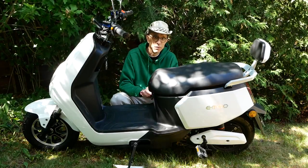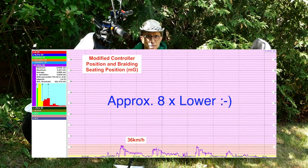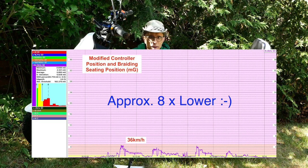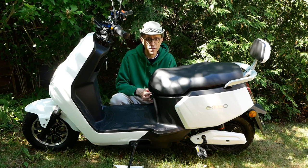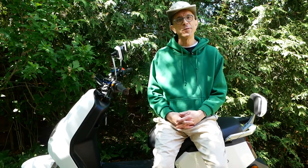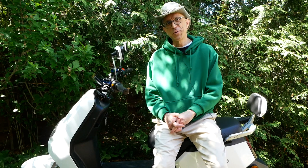Here's the chart showing the levels we had before, and then after moving the motor controller to the new position, here's what I'm seeing now. After going through all this, it was very much worth it, but I feel badly for the people that can't do these sorts of things. So again, if there is a manufacturer watching this video, they can just think about where they put their motor controller. In short, there was a solution to this problem — yes, it did involve some wiring harness changes — and if you can't do those sorts of things yourself, you probably know somebody that can help you out.